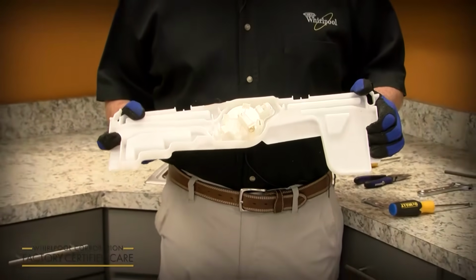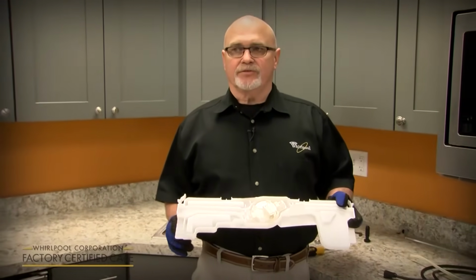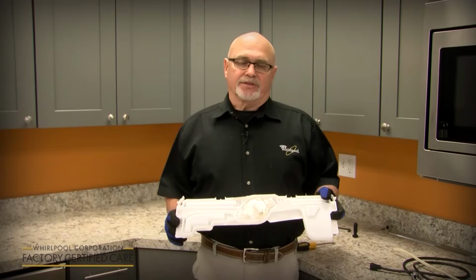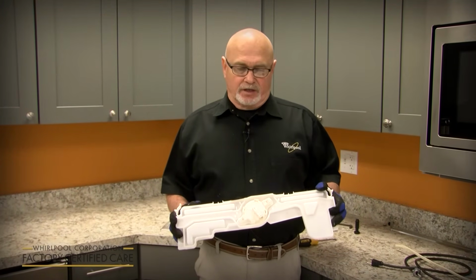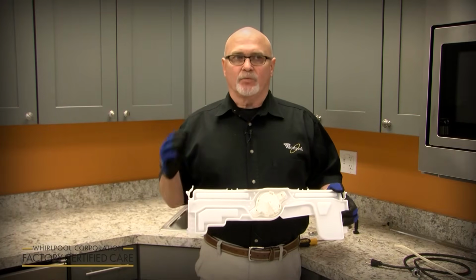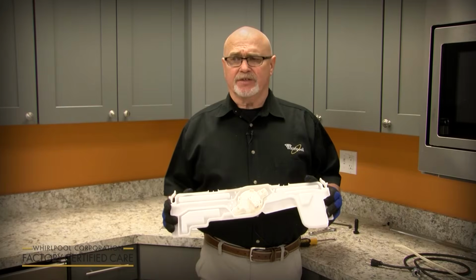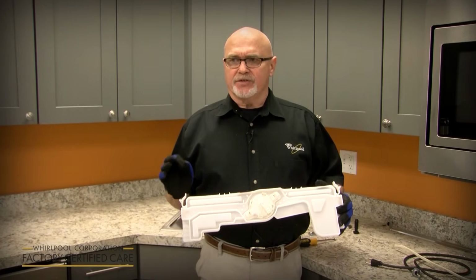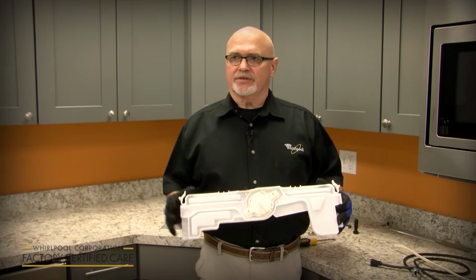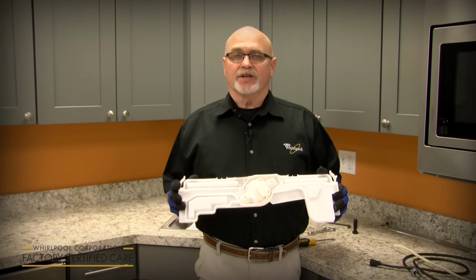And that install service cycle is a real quick key dance, 1, 2, 3, 1, 2, 3, 1, 2, 3. If you're successful, all the LEDs will come on, and then you can rapid advance it steps 1 through 6. Step 1 is drain, step 2 is fill, step 3 is wash. And like I say, it's a short 5-minute cycle, or you can rapid advance it to whatever portion of the cycle that you want. And just to make sure we're doing this so you check for leaks.